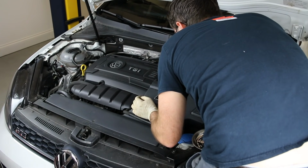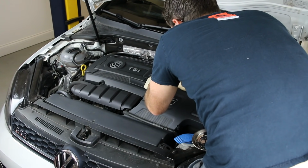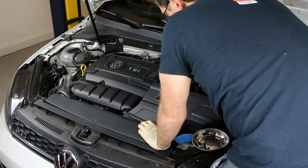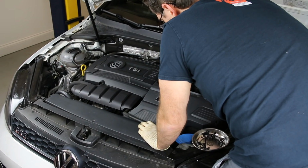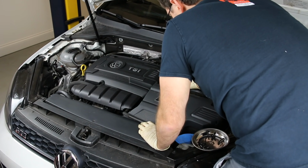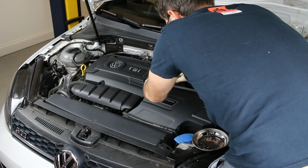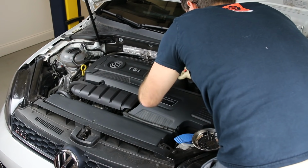We have this vacuum hose here on this particular intake. It's on the side of the filter housing here. What I like to do is take a pick, because a lot of times these hoses will be tough to pull off. Take a pick with either a 90 or a 45, kind of run it inside the hose, and then work it around. You'll break that seal that the hose has on whatever it's on, and then you should be able to just work it off from there.